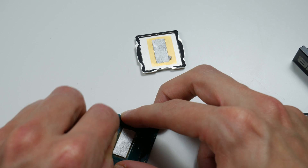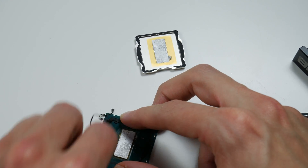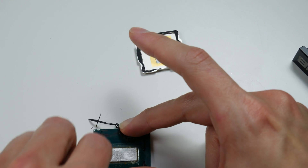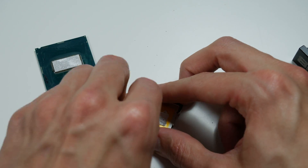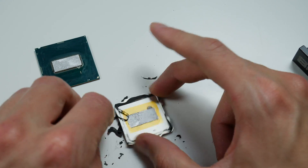The silicon is okay with 150 W/mK, but the indium only has about 80 W/mK — so that's the limiting factor in our system. Also, the thickness of the layer is really important because it's a linear aspect. The thinner the material, the better the thermal conductivity becomes.